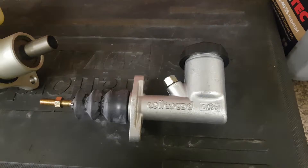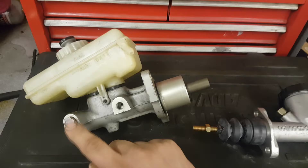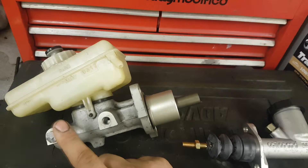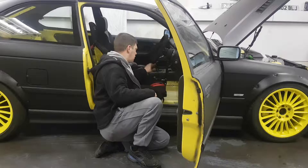After a bit of toing and froing and talking to Ryan from Drift Defensive — shout out to him — we decided to split the brakes off again because he didn't really need the rears on anyway. So I bought myself a Wilwood standalone cylinder with a reservoir at the back. There's the new Wilwood cylinder going in, and there's my original master cylinder — I've put some weld over the fitting and ground it down so it won't pass anymore, it's blocked off. That's going to my front brakes, so I'll have front brakes and back brakes in hopefully an hour — that's the plan.